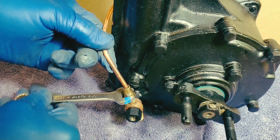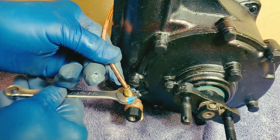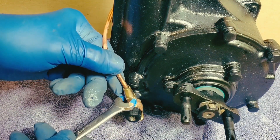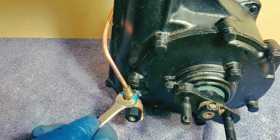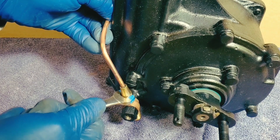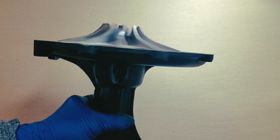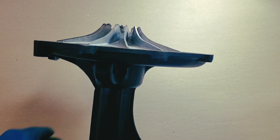It's very common for this outside oil tube to be crushed or mangled. In this case we have one in stock and did it up for Chester. It was less money than replacing and forming the copper, which we could do if we had to. And there you see the supercharger running very smoothly after the rebabbitt job.